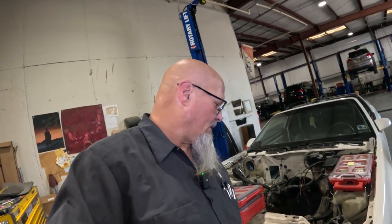You can buy these motors for like $150, half the price that they used to be back in the day. Of course, they're aftermarket. But they make kits. You can take these apart and replace the gears on the inside. Sometimes it's bushings that have just crumbled and come apart. Sometimes it's a stripped gear. I would like to put power and ground to these and find out what they do, take them apart, look at them, and figure out which kit I need to get, rather than buying all the kits and seeing what happens.